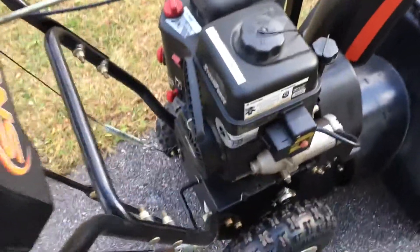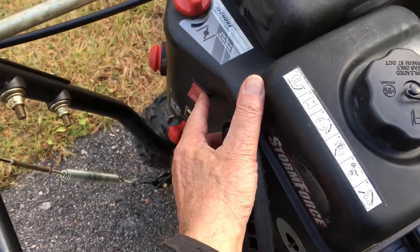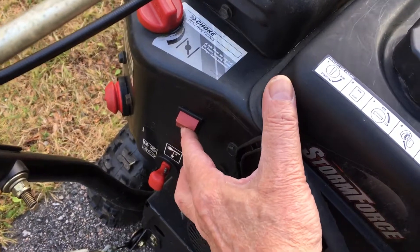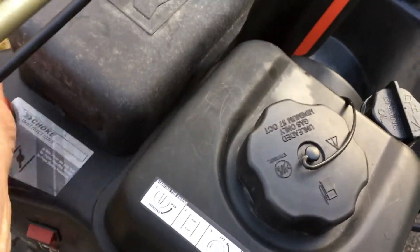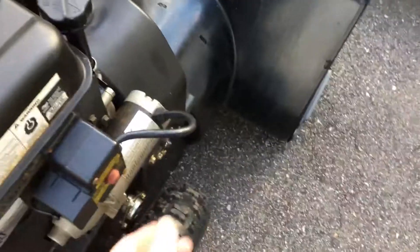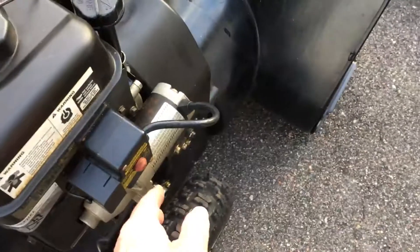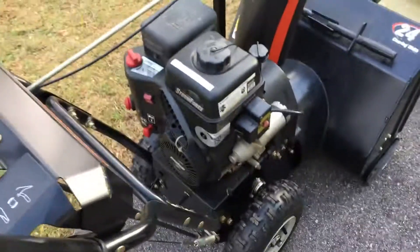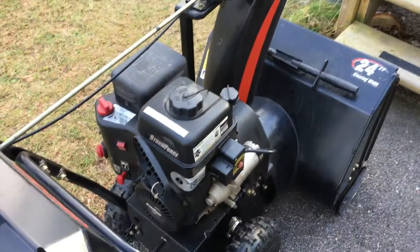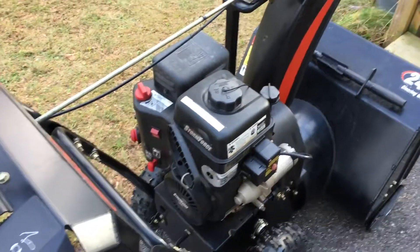You've got to turn it on — I have an awful habit of trying to start it without turning it on. So: off and on switch, the choke for cold starts, no more than three squirts on the primer, and press this button to keep the starter engaged. If it's a hard start, don't run the starter more than about 10 seconds at a time or it'll get hot. Keep it full of gas, try not to get snow in the gas tank, and keep it covered up.